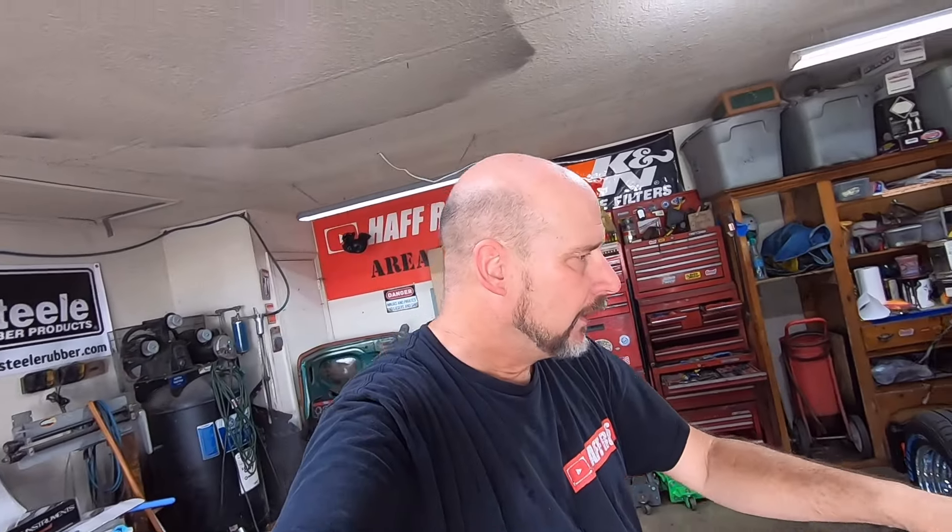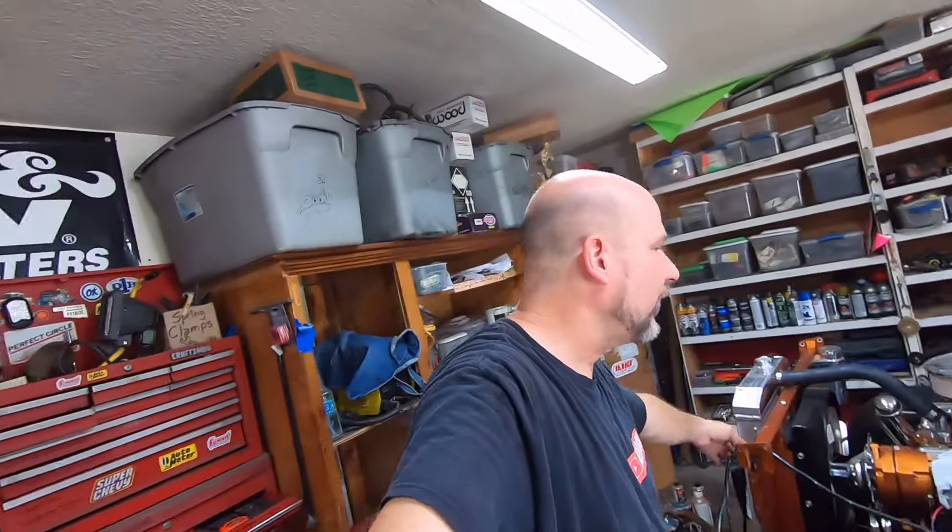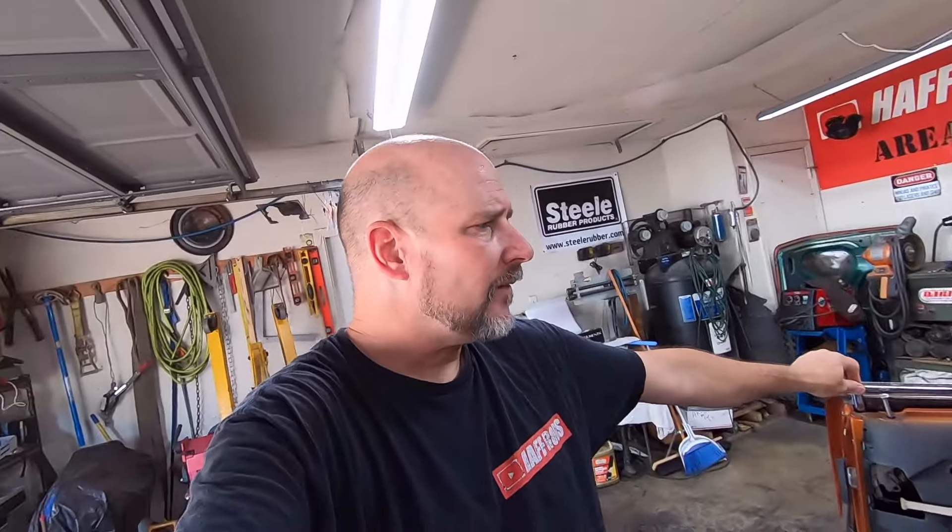When you go to add a bunch of electrical accessories to your car — like an electric fan or an amplifier for a car stereo — you're going to need a bigger alternator to carry all that load. So if he goes with air conditioning, an electric fan, a fan probe, and all that, it would probably be a good idea to upgrade to at least an SI12 alternator. That's what I have on mine. Just kind of running into issues with the wiring harness being too short now because it was cut to fit when it was first put together as a basic 55 with a stock steering column and a triple gauge set. Now we have the instrument cluster, the classic instruments kit, electric speedometer — quite a bit of changes to the wiring. That's why I think it'd be better to just put a new one in, because right now none of the front is wired up. Now's the time to do it.